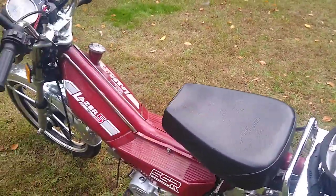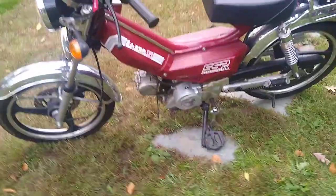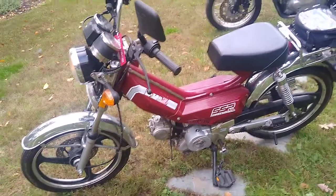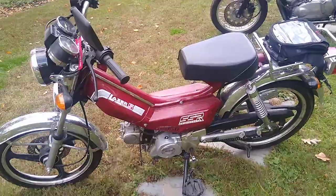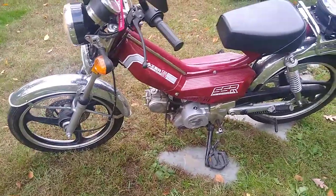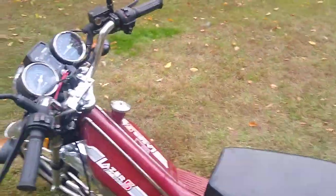The quality is... when you get to the seat, it's not great. But this thing has 1,700 kilometers, which is just over a thousand miles. The only things I've had to do to it — and I know the person I bought it from did nothing except ride it and change the oil — is that the chain had stretched by 1,600 kilometers to the point where I had to change it. It was at maximum adjustment; the stock chain was garbage. Other than that, and a tail light bulb going out, that's it.